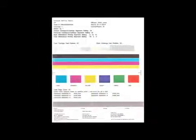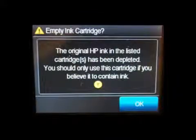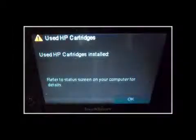To help identify which color is out, print an internal self-test print quality report or choose one of the test prints from inkjet411.com website. Refer to test prints. Test prints are designed to fire all nozzles by color and will aid in determining if a particular color is out. For select cartridges which do not have the smart chips replaced or reprogrammed, additional alert messages may be observed, including low ink, counterfeit cartridge, or non-genuine ink cartridge. These are normal nuisance alerts that can just be ignored by pressing Continue, Dismiss, or OK.